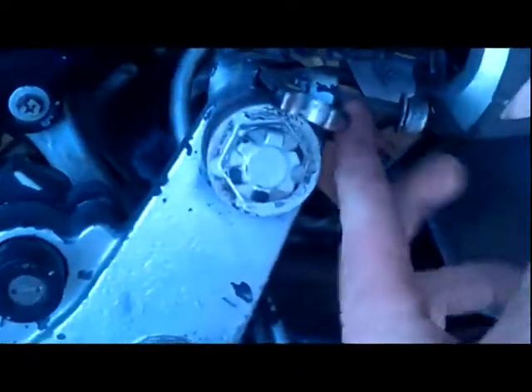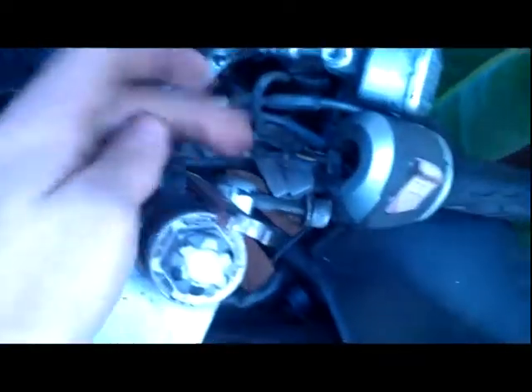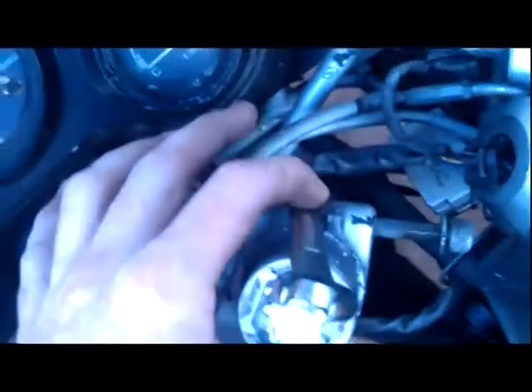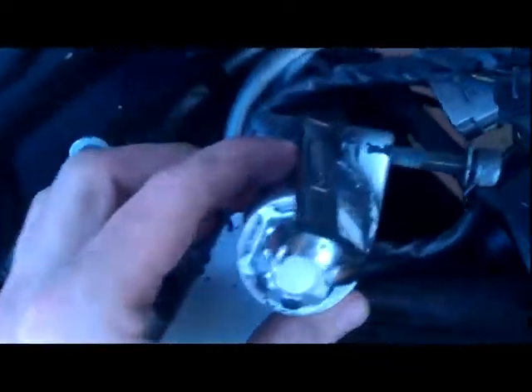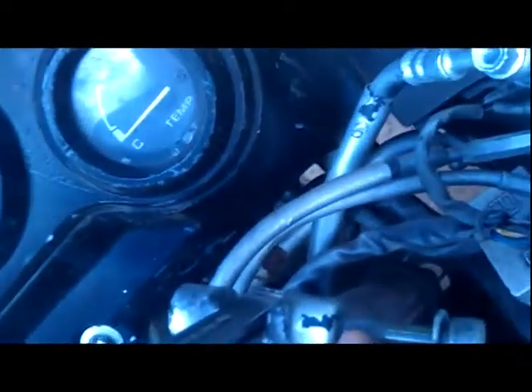For the top, you have to be careful because you don't want to damage the threads on this bolt. I basically took the bolt that used to thread in from this side — it threads in this side but slides in the other — and just turned it around and put it on the other side. Then I used a 10 millimeter wrench because it's flat on both sides and small enough to slide in between, and I just tightened the bolt just enough to start pushing against the edge.